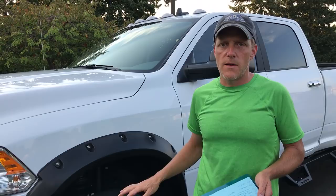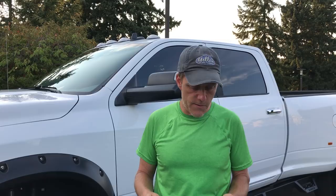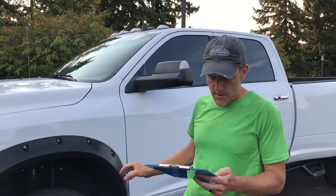This particular leveling kit wasn't expensive, does the job, is really thick solid steel, and does not require you to change the shock — it has a separate bracket for that. The reason I wanted the airbag is that raising the front end with a leveling kit can make it look a bit proud compared to the rear end, especially when you're hauling or have a trailer. So when I'm driving around town it's nice and level, and when I hook up a trailer I just plug a little air in, level everything up, get the right drop hitch, and it's safer and looks right.